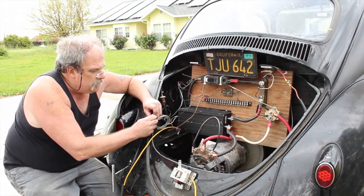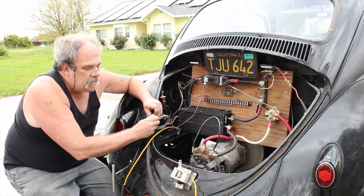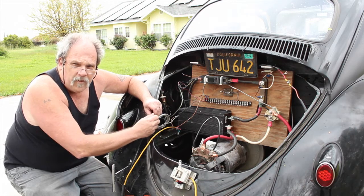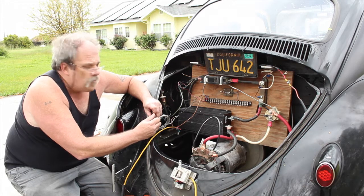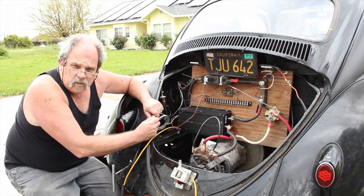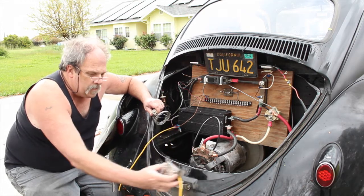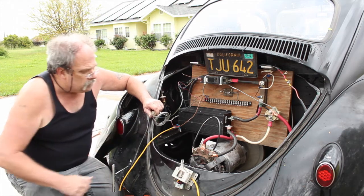Motor's running great — that sucker just spins right up. It's got some good power. I'm just shunting over on the field, all the voltage on this. It's got 72 volts, 144-volt controller, 800 amps for this one, and it is working. I'm going to replace the pot and put it in the casing, and we're going to give it another shot on the road to see how this controller does.